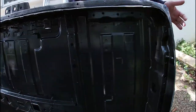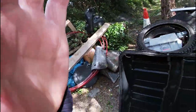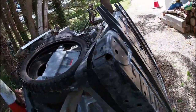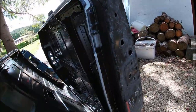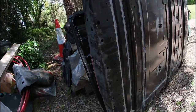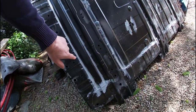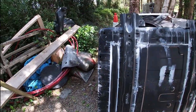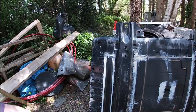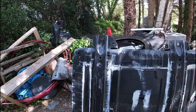I was thinking — what if I drilled out all these spot welds and took away this outer protection, which I don't really need? It's not going to form part of the structural integrity of the car. So first of all let's do the cut here, get this separated, then drill out these spots to see if we can peel away this outer protective skin all the way down. Take that away, leave this in because I think this is the central spine which will give us some really good structural integrity and protection underneath.